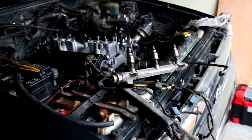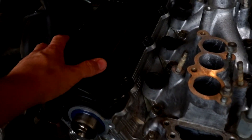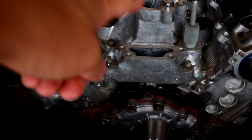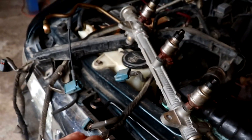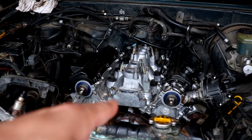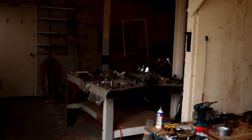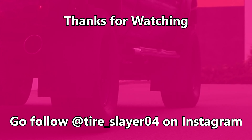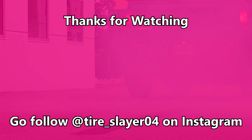We got a bit of a minor update from working on it a little bit. My dad's just getting a smaller torque wrench so we can make sure we torque down these brackets right. Pretty much from there, we have put on the lower intake and torqued down all these bolts. We have this laying here, this laying here, the fuel rail — the other half is sitting over there. Part of the fuel rail is gonna sit here as well. We're also gonna torque down the camshaft brackets, make sure that's all good, and then from there we can build up to the upper intake which is sitting right over there. We're making progress, it's going pretty well.